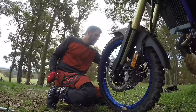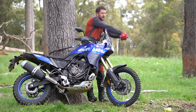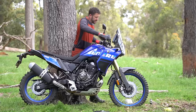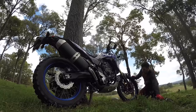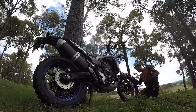It's up to the rider — don't take my word for it. If you feel comfortable getting a torque wrench, do it. Calipers are done, axle's tight. Last thing are the pinch bolts on this side, but you leave that to the very end. When you drop it back, it pays to come around this side — don't do it from that side in case when you release it, it falls off the stand and comes away from you. You've got better control here. Crack the tie down. Don't forget to pump the brake. I always like to give the fork a good crank down. Don't forget to nip up these pinch bolts — seated nicely, get those even. Get a torque wrench if you're not confident. Job done.